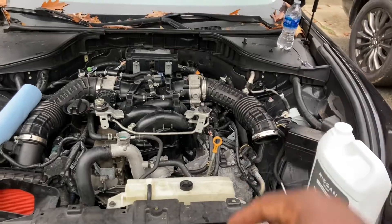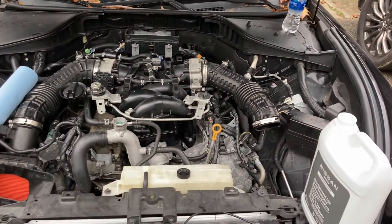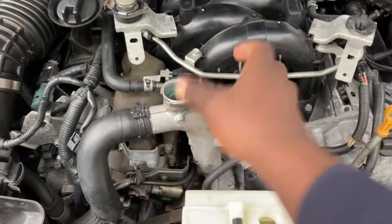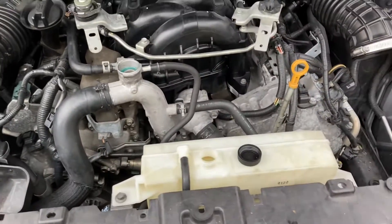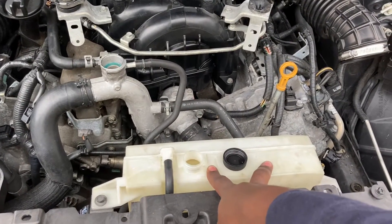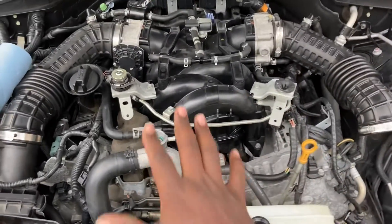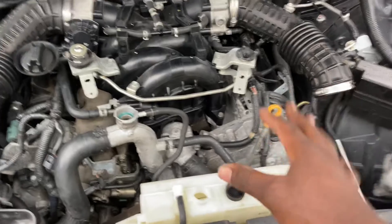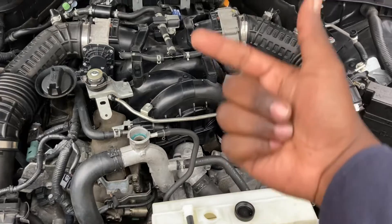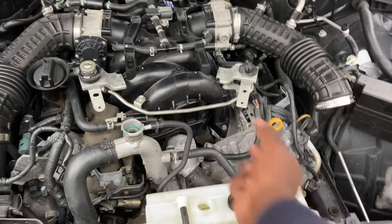In these vehicles there are four points — four different entry points or exit points you'll be paying attention to. There's the radiator cap right here; this one goes on to the filler neck, and as the name says, this is where you fill the coolant system. This one here is your coolant reservoir — it goes by other names, but this is where excess coolant goes. Once you have enough coolant in your system, this acts as a buffering container.